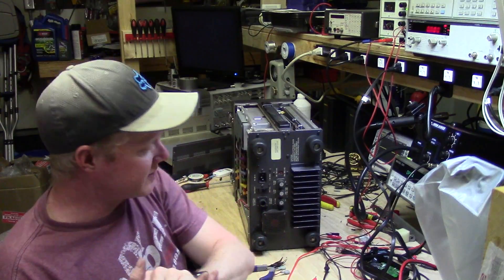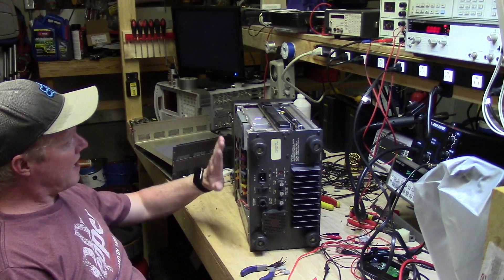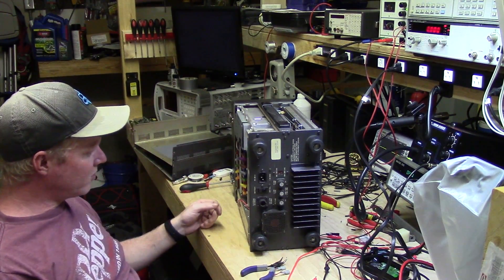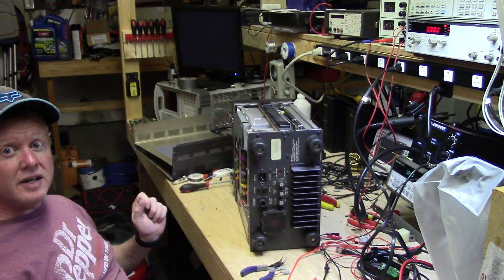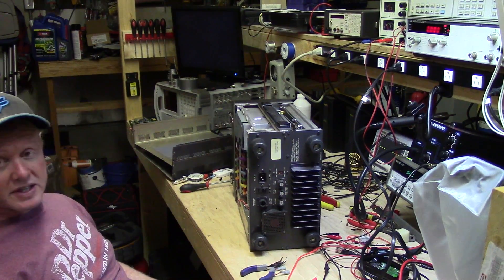Both batteries are out now. This is a safety thing I just wanted to remind everybody about. There's a high-voltage section up here in this area. You're going to want to make sure that if you plug this in, even if it doesn't turn on, you check that high-voltage area and make sure that you discharge everything before you start working on it. Otherwise you could get a nasty surprise.